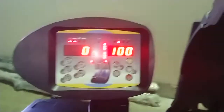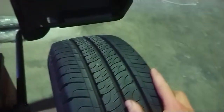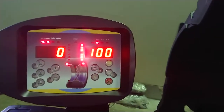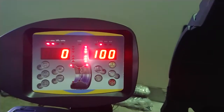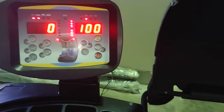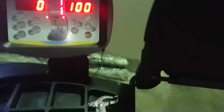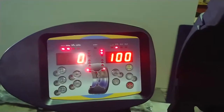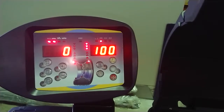Put on the brake - that holds the tire in position, so as you can see it's not moving anywhere, still at 100 grams. Then you just knock the weights on at the 12 o'clock position. If required on the inside, the light would come on as you're trying to find that inside measurement, and again knock it on at 12 o'clock. Nice and easy.